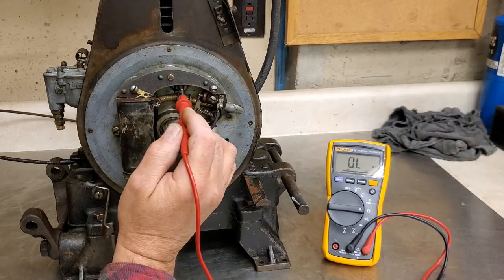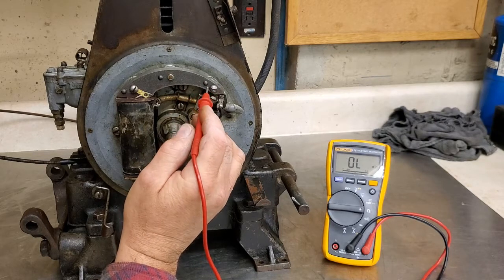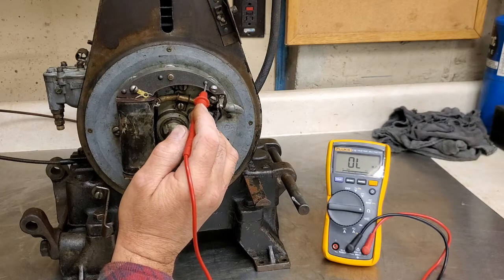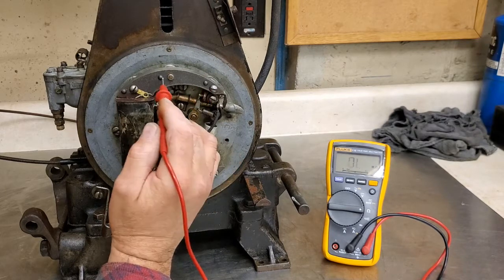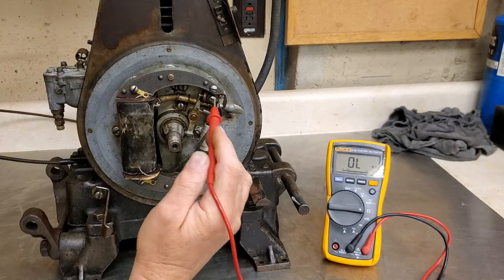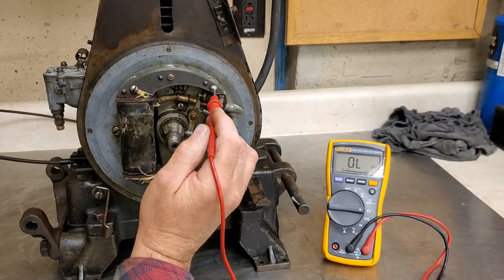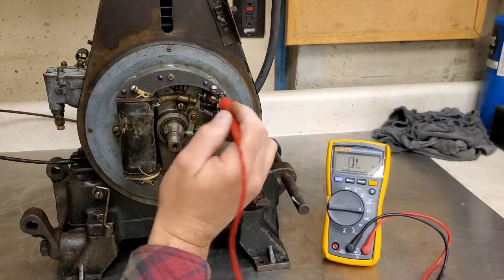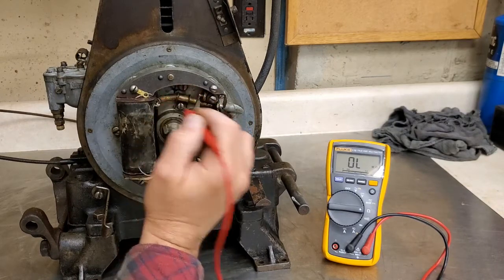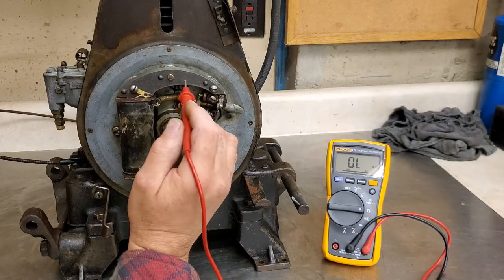I actually took the Briggs Model Y coil to use on this, and with the rivets, I showed you, if you saw my last video on the Briggs PB, I talked about the Hansen rivets. So I drilled through here and riveted this together so that I was able to go ahead and take the pins out, because the Briggs Model Y will have 4 locating pins in the corner. Once you take the locating pins out, the laminations will come apart. So if you're going to use a Briggs Model Y coil on these, that's what you got to do.